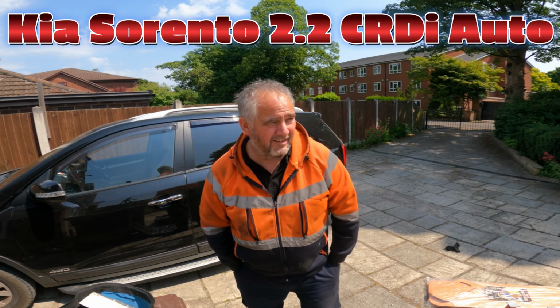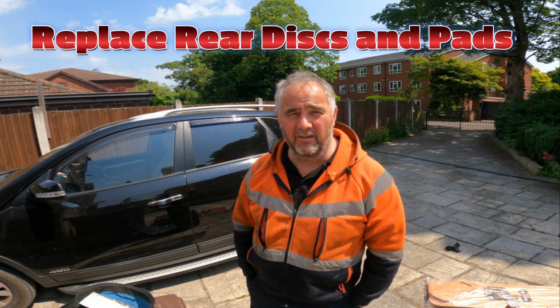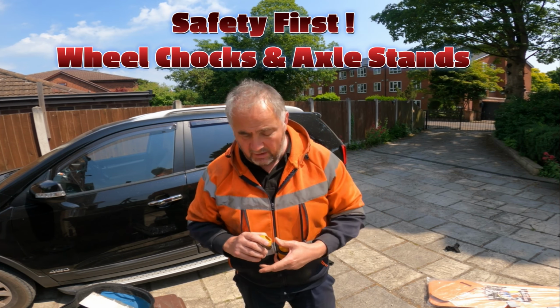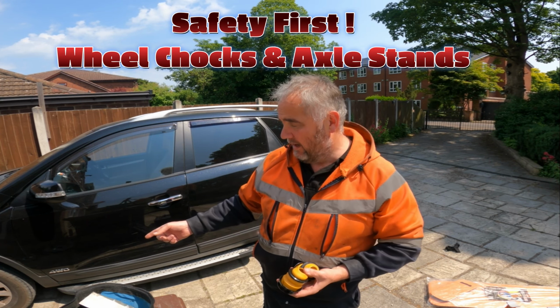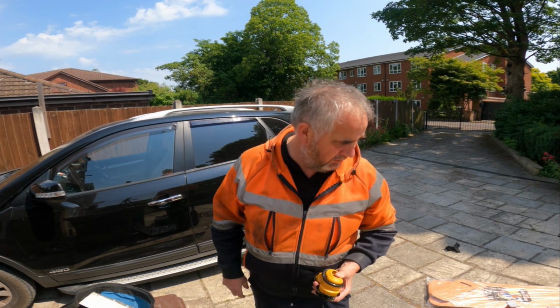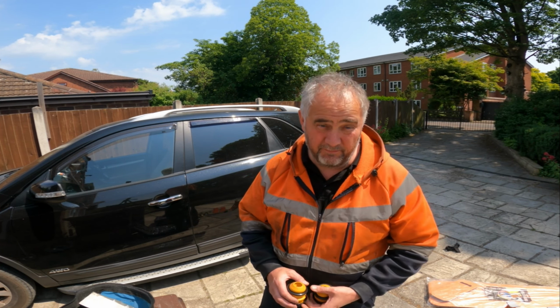Okay, so today we are going to be changing the rear brakes, the discs and pads on the 2010 Kia Sorento 2.2 auto diesel. So first thing, get the car jacked up, put your axle stands underneath when you get it jacked up, put your chocks around your wheels, get it all safe for you to work on.